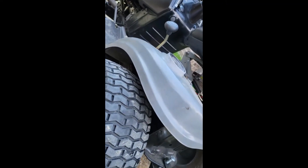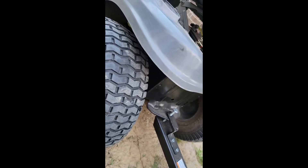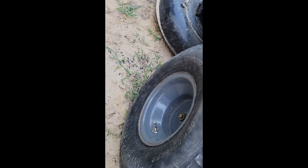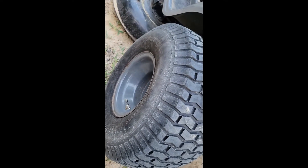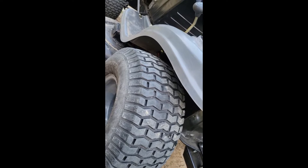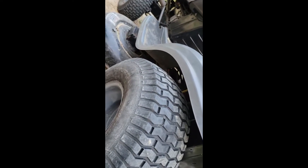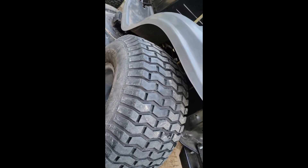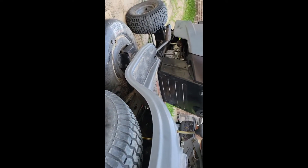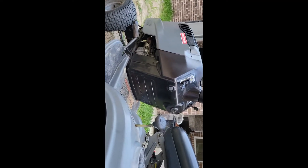One more annoying thing — there are a lot of annoying things about this mower. First, flat tire — the valve stem just broke right off while it was sitting in the driveway. The most annoying thing is you cannot back up with the blade running. I searched online and found there's a switch on the shifter that detects reverse and shuts the blade off. I found the cable and pulled the wire off, so I should be able to go in reverse with the blade running now.